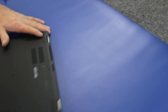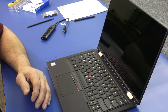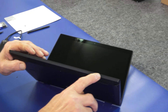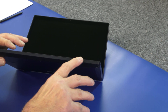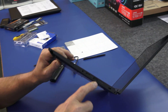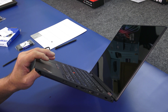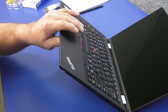Make sure all your screws are nice and loose. Before you get inside your laptop, always make sure you're protected against static discharge — you don't want to be zapping your new computer. Use a wristband or whatever you have. The seam runs between the palm rest and the bottom, right along the edge. You want to be careful putting your tool in around the ports — you don't want to be bending the chassis around where the ports are. Use a plastic spudger tool; do not use a metal screwdriver because you will damage your laptop.